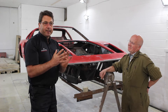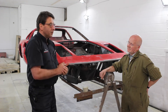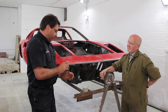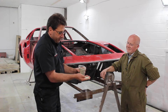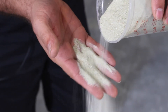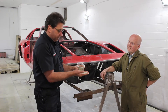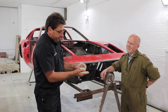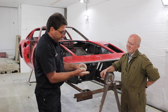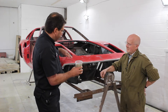Do blasting. Obviously you've got to be very careful because this is a steel car, but Ron also does all our aluminium cars for us. So the key to this is what they actually use. We've got the blasting media, which is like a soft sand, and in various cases we've got from a very fine soda we'd use on the paintwork and the aluminium cars through to something slightly more coarse for the chassis and underneath work, because in the wrong hands we can do a lot of damage to the panels.